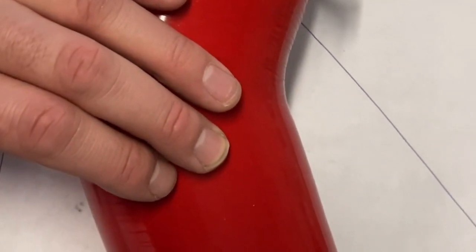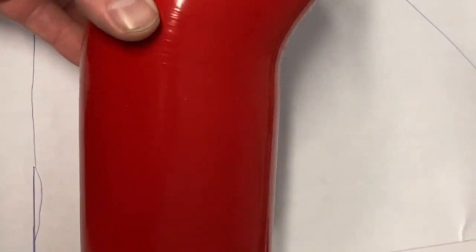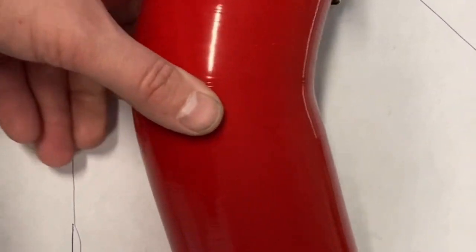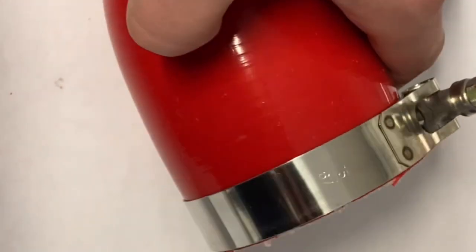So I will be having to cut down this part here a bit further just to give me some more space, and that will actually give me the couplers that I need. The first thing that you realise when doing the plans is that there's not a lot of space in the engine bay. So I've cut down the 45-degree pipe — the best way I find to do this is to put another 70mm piece into the end to give you some stability and then use a hose clip or a clamp to give you a cutting edge for the Stanley knife.